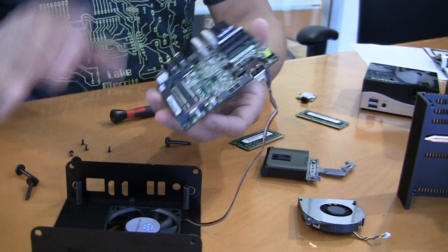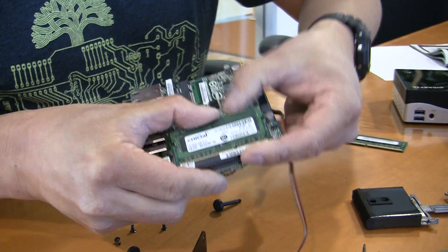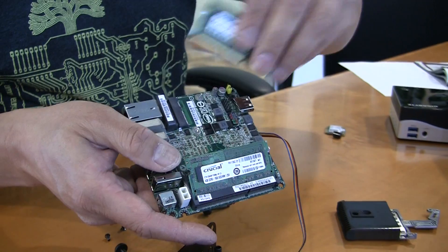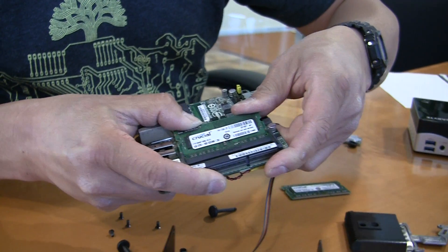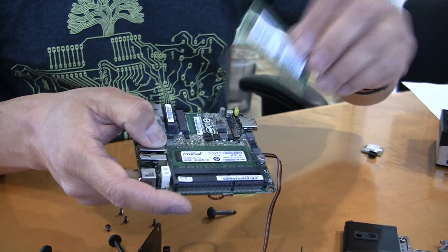I forgot a very key step. Besides building your own, if you do this on your regular NUCs, you're going to take your RAM modules — this is DDR3 — and slide them in. Just like a laptop, they go in at an angle. Push them into the edge connector and clip them down. You should do the bottom one in first if you're doing two modules, and you should do two memory modules, otherwise you won't be running in dual channel mode and you will take a hit in 3D performance.